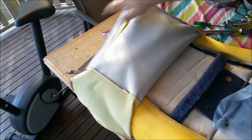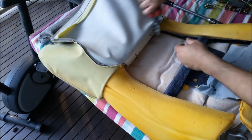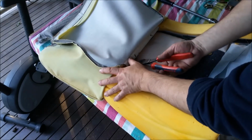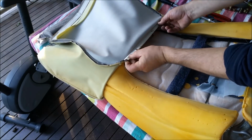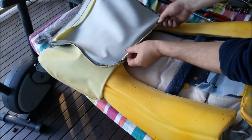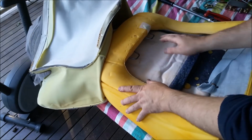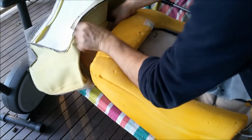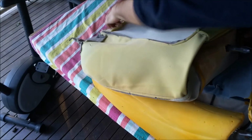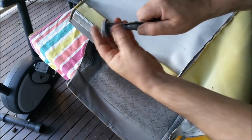Right, turn him around. Another listing at the back here. And I'm just going to twist those off. That wire will withdraw as well, provided I don't get it. Yep, that's the way. And the headrest brackets, you can feel, you just push them and squeeze them together. And that will release the cover. And these headrest brackets, what I was doing is just squeezing like that and then pushing out.